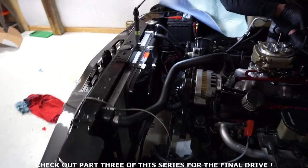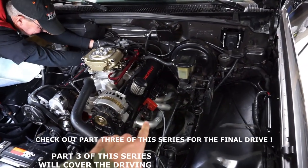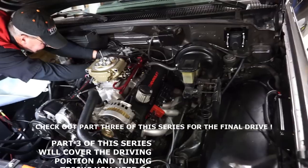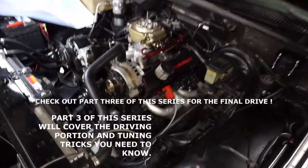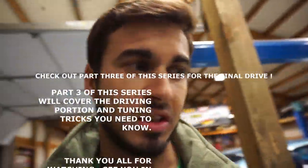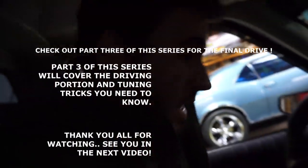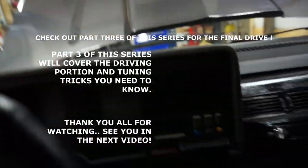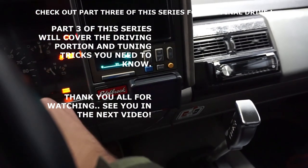All right, guys, so what we quickly discovered is we started getting a lot of heat back here in a couple of these cylinders. It got up to 160, and everything's started. Let's get this thing adjusted. Everything's working. So what we had to do is adjust the timing. I set the static timing at 15 degrees, and now that we've set our static timing, we're gonna verify it with a key crank here. So let's see if she's happy.